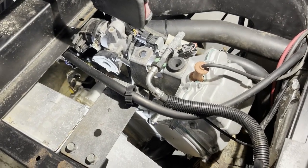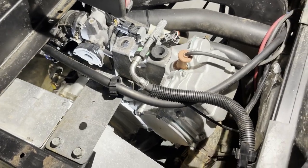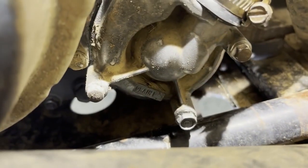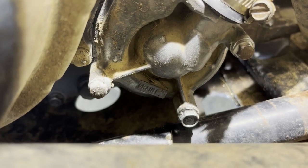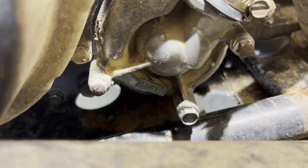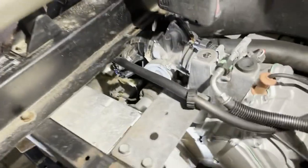The first thing you're going to do is fill your radiator up full of antifreeze. Then you're going to want to get a wrench or socket and come over here to your water pump. Down on your water pump it's got an arrow that points toward the drain — you're going to pop that screw out until you're getting water flow out of it, then reinstall it.